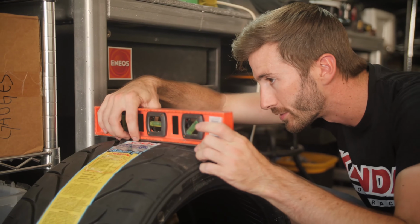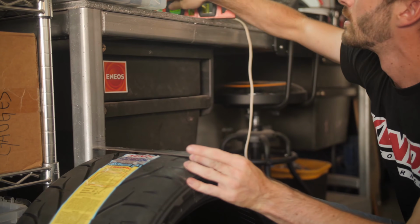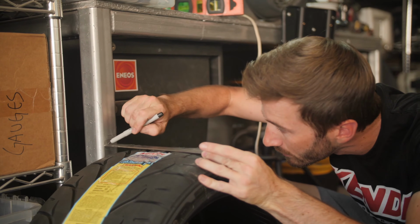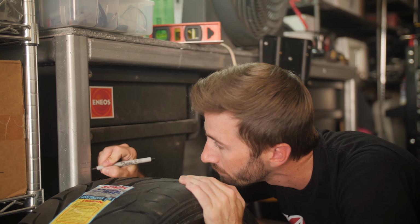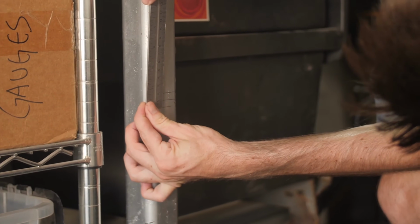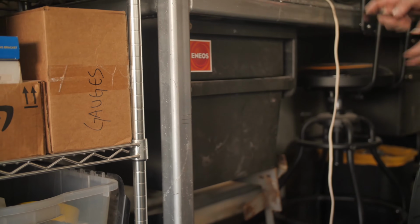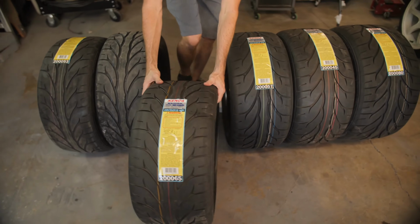So here's where we're going to start to see some interesting differences. Despite this being quite a bit larger tire, look how much shorter, whoa, hello. Look how much shorter it is than even the 235. So this is the 255. So if we pull out the measurement here, you're talking almost another centimeter, looks like 9 millimeters shorter than the 235. So you could run this up front if you don't have any problems with the width clearance, but you do have problems with height, then this would actually be a shorter tire than even a 235.